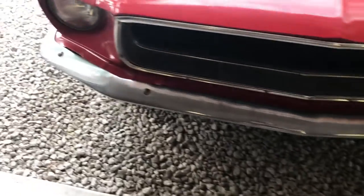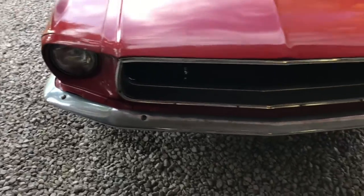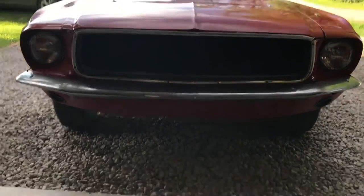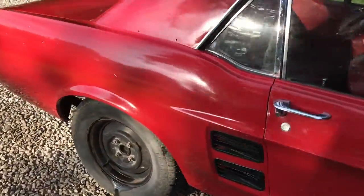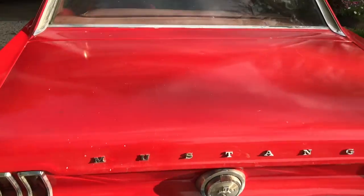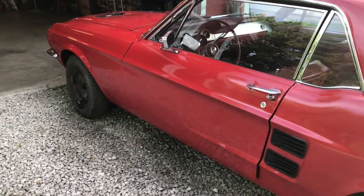I polished the front and rear bumpers — they were all rusted out a little. Some Scotch-Brite pad and some Brasso metal polish pulls them right out. I took the little wing flying-V pony emblem out of the grill so it's got that more aggressive-looking bullet look — looks way better without that in there. She's looking a lot better already, back bumper polished, no more rust. These are just little OCD things I had to do before I even pull the motor. Thanks for watching, stay tuned for the '67 Mustang restomod build.